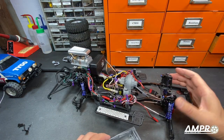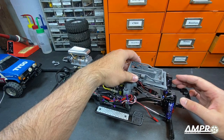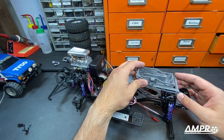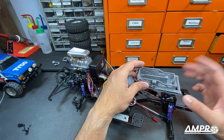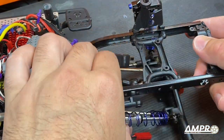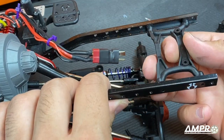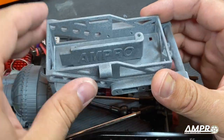I've already got the rear suspension taken apart, but basically we have to take off these shock mounts. This bracket, theoretically — assuming I measure everything correctly — should drop straight in here and give you a place to put your battery. You have to remove the rear mount as well and do the other side. This bracket will then be removed and the new one will slide in.